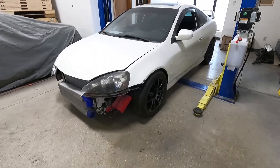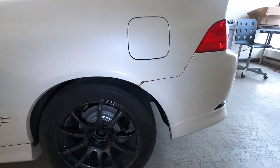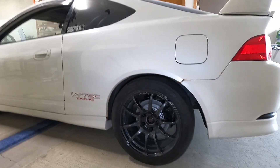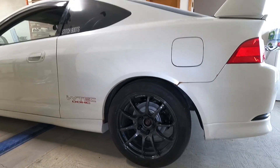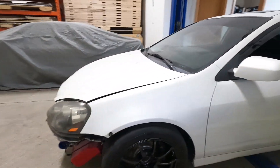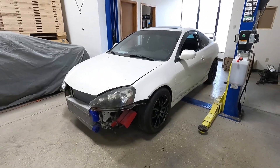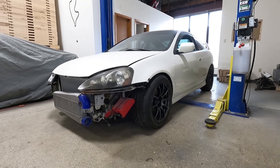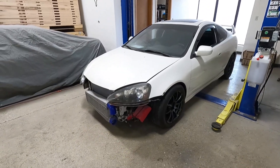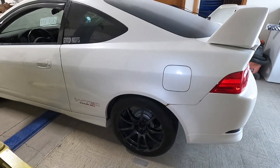Car's on the ground. I moved it back and forth a bit to help settle to the actual ride height. It is still a little high in my opinion — about less than two fingers in the back — but I'm okay with this ride height. I think this will be very streetable. It'll definitely be an issue for guys that want to slam these cars when going all-wheel drive, but this ride height is not too bad. It has a bit of a rake — the front is a little lower than the rear. Only time will tell once the coilovers settle fully if I need to adjust further.